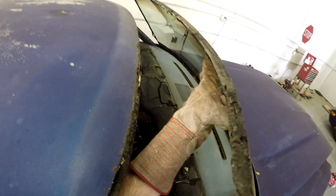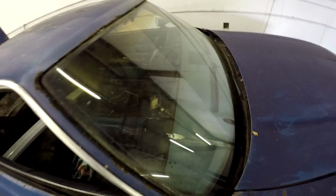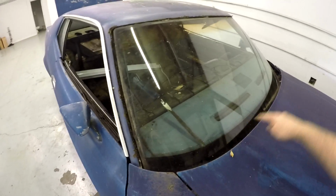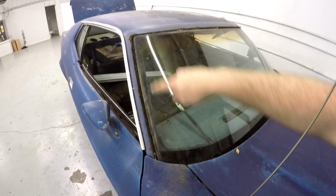And that's all there is to it. Got this piece of glass all the way out. Just got to pick it up. Might need to get some help before I try to lift this thing out of here. But it's totally detached. All you have to do is just run along this edge with the Sawzall blade that you can see down here, still stuck in there, free this up, and then just use a razor blade around the edges.